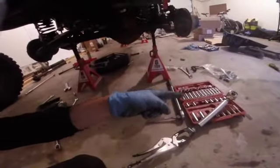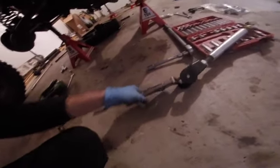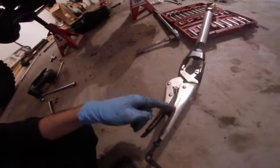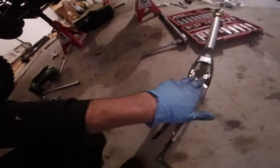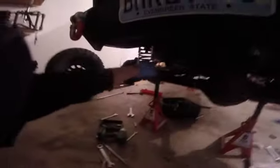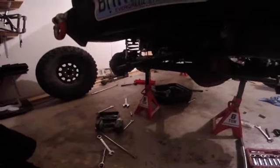The upper control arms in the front, you either have to drill out the hole that's in the bushing there, or you can reuse the old bolts. That's what I chose to do. And then as far as getting this mount on in the uppers, I had to use this spreader vice grip to get it wide enough. Otherwise, I really could not get it wide enough to fit over that bushing. You could also replace the bushings at this time if you want, but I'm not choosing to.